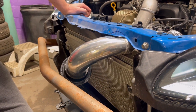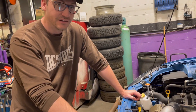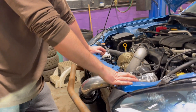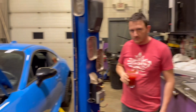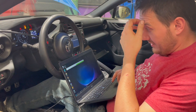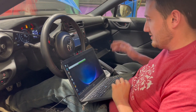Trying to pick up some cooler air, and also getting an idea on routing for a future intercooler kit, which will probably hang off this crash bar. So lots of fabrication in this kind of beta test mode right now. We're just going to load a new tune onto this thing — I just put a new MAF housing slash turbo inlet on it.